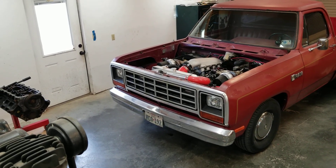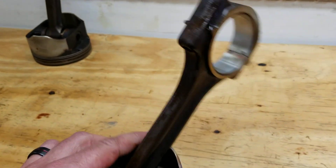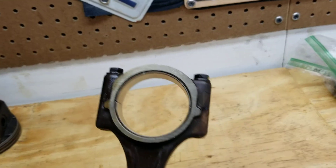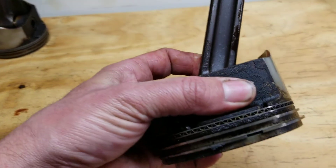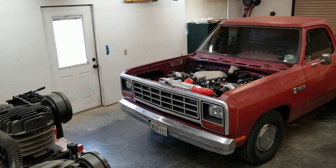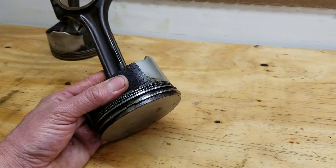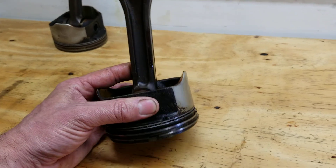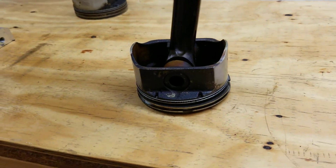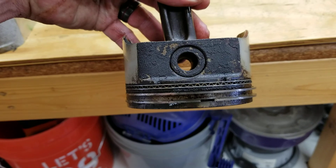The thing is, when you do that pine sol soak it is going to take the coating off of the piston skirts — but she doesn't care, she still runs great today. These rods, because these are Gen 3 rods, just don't seem as beefy as what I recall the L33 rods being. That one's kind of a hybrid — it's got some Gen 3 stuff on it, some Gen 4 stuff, and the rotating assembly is more like a Gen 4, which is stronger. So I can see why these would only be rated to 650 horsepower, as the popular saying goes. These are pressed pin, not full floating. A full floating pin obviously would have your C-clips in there, like the L33 had.